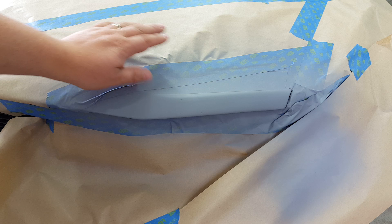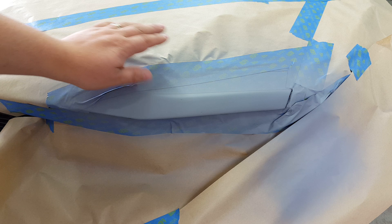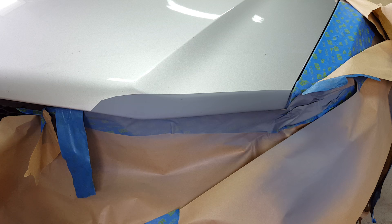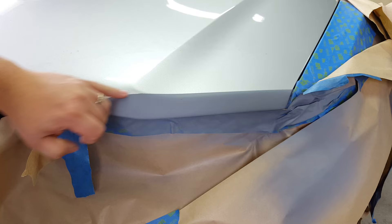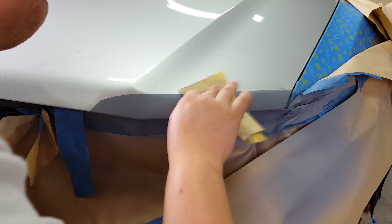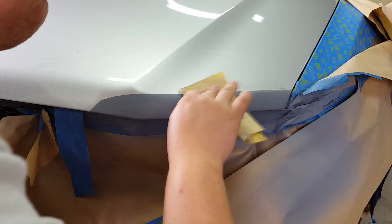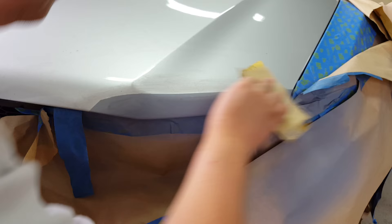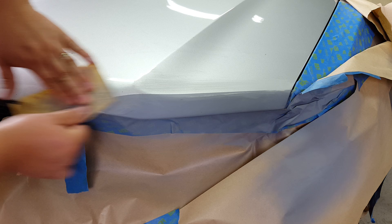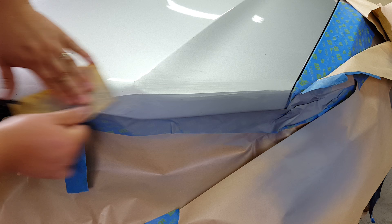Now we're ready to unmask this, give it just the lightest sanding to smooth out any little lumps, and then we're going to start applying color and feathering it, blending it all back in through the previously painted section that still has good paint. This is where our pass or fail will really come into its own. What we want to do is feather this hard edge back so we don't end up with a transition line between our old paint and our new paint. For that I'm just using a little bit of 400 grit to go along the edge — you want it so you can't feel a lip.